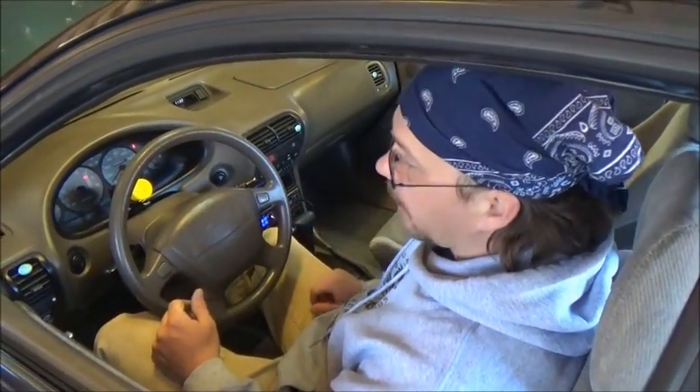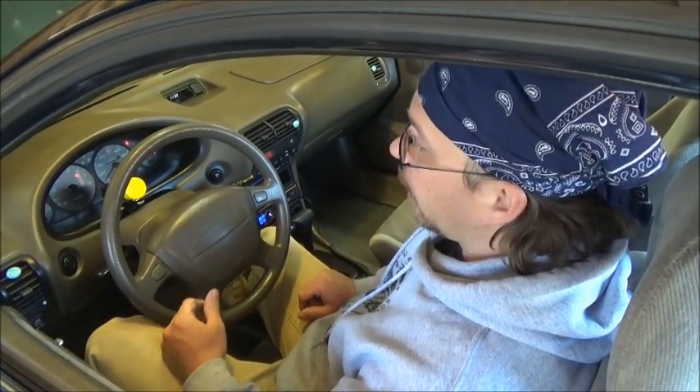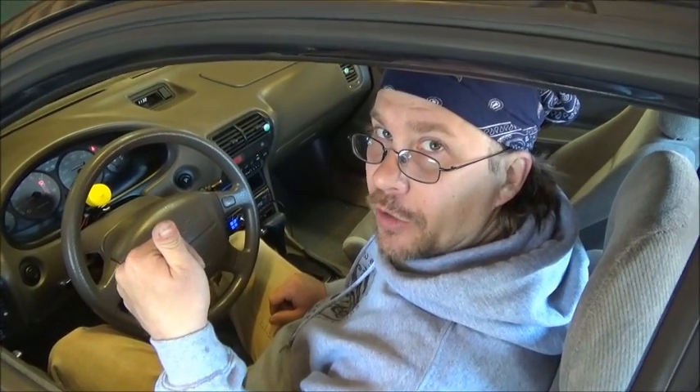Now just see — we clearly fixed it. That was a nice clean sweep, worked flawlessly, and the shift light came on when it was supposed to. It's set at six grand right now and I'll adjust that for ideal conditions at the track. So if you have a jumping tach or any other issues like that, you don't need a new distributor every time. Coils usually either work or they don't — no spark, no start could be the coil or the ignition control module. But tach issues or intermittent funkiness like that — that's usually the module or the igniter.